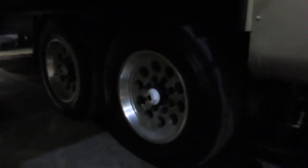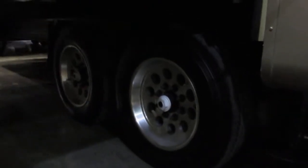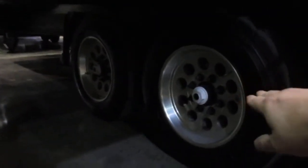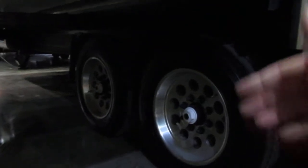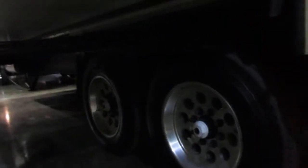When you're talking about something that weighs 14,000 to 16,000 pounds like these do, you've got to have heavy-duty stuff. You have heavy-duty axles — these are commercial hubs, oil-filled, eight-lug. These are truck tires, not even RV tires; it's the same thing you'd find on an F-550. These are seventeen-and-a-half inch rims.